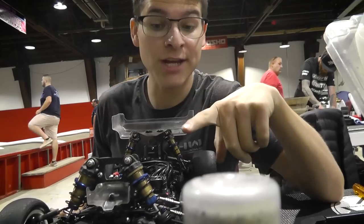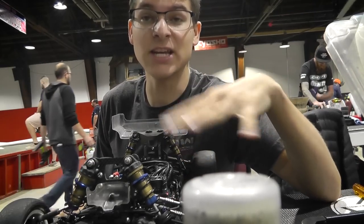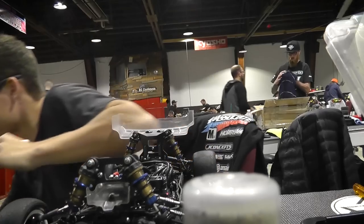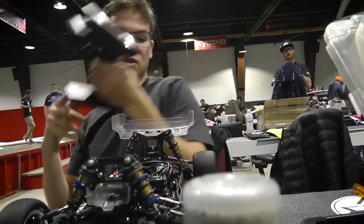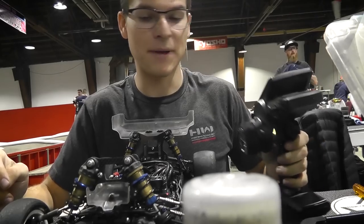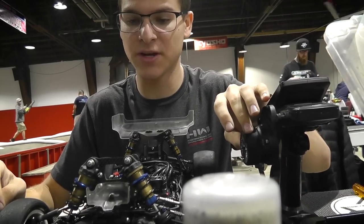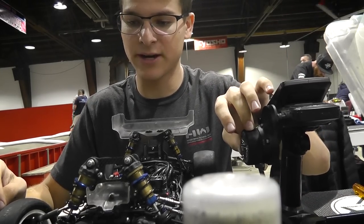When changing your Ackerman to the different spots on the rack, your EPA is changing your radio. So a lot of people forget about that. And does your toe change too? The toe does change, so you had to readjust that. Had to readjust the toe.